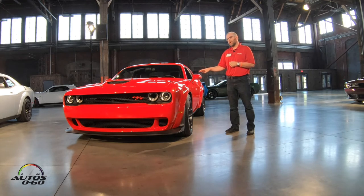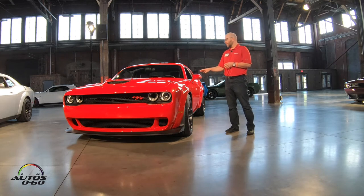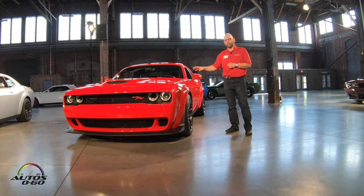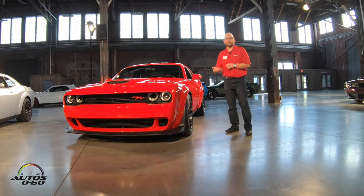When we started on this project, the idea was to put wide tires and fender flares on it. A few of us got together and asked: can we go a little further than just a wide tire and still maintain street manners? So we put 14% more spring rate in the front, much larger sway bars front and rear — 34mm front versus 32mm, 21.7mm versus 19mm rear — and retuned the shocks, both hardware and electronics.